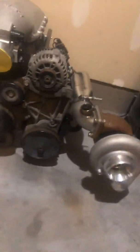I've also been doing some research on injectors and the fuel management system. I'm still going to run that T56, so I've got to get a bell housing and a monster clutch, probably stage 3 or somewhere up in there. And I've got to get the pedals from Six Speed Money, something like that. He has a whole kit with the pedals, the slave cylinder and a master clutch cylinder, which I already looked up is like $300 online. So I'll probably end up doing that.